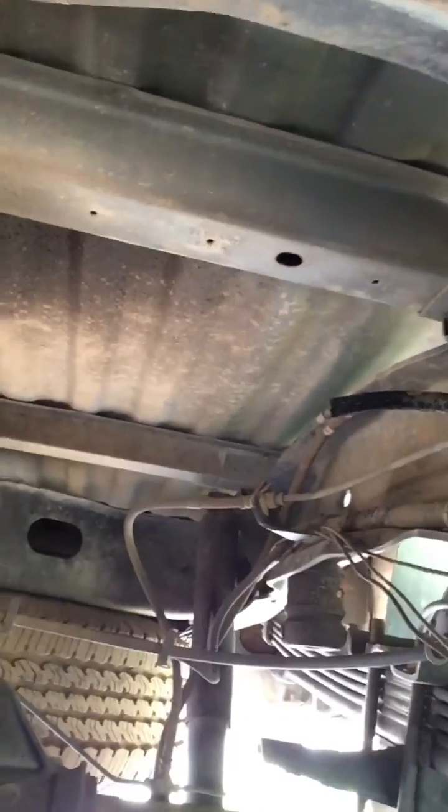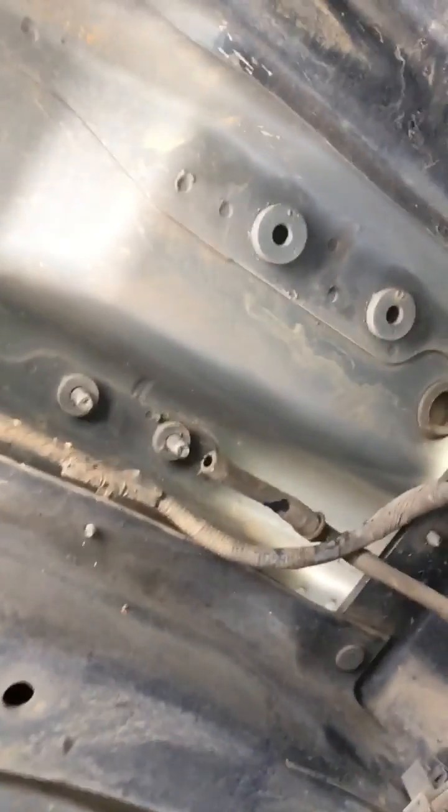on each side. You see there, the little blue tabs. You've got a little tool that pushes the fuel line off, and then the smaller return line there, you just push on both sides of it, and you've got an electrical connection. On the back, there's a vent line that needs to be disconnected, and then also right here in the middle of the tank, a vent line.